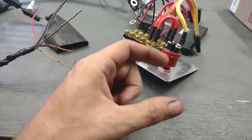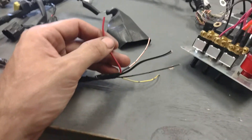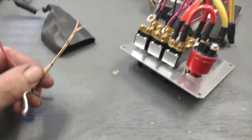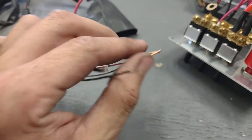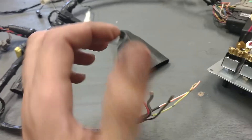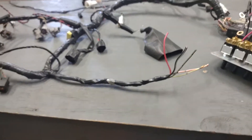If you jump over here to any one of your ignition switches, you're just going to have two additional wires — your red and your orange and white — that are going to go to the ignition switch. So these two go to the ignition switch, and those two go to the push button. This particular harness has the yellow with the green stripe coming up here to it; that is sending 12 volts to the starter solenoid, so it needs to be tied to the orange and white. These two wires get power when you turn the ignition switch on, and this all-time hot is coming from your battery. If that's all you need, you can stop the video here.